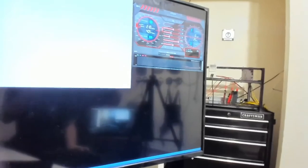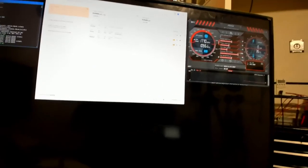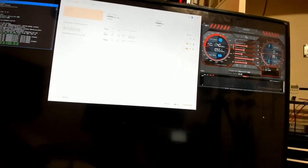This is actually meant for racing. Okay, let's start at my 3080, the power limit is 70. The memory clock is 1300. If you're mining with these, you definitely want to underclock them. And so you start the 3080. And then it popped on this page. Always it pops up on the first page. Okay. And then these 3080s, the room has to be below 79 Fahrenheit, because when these cards run above 60 Celsius, they do not like that.